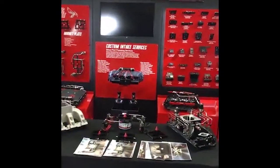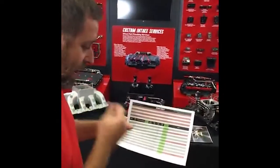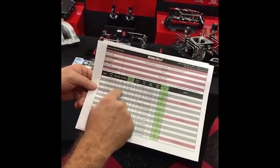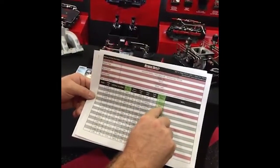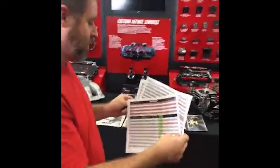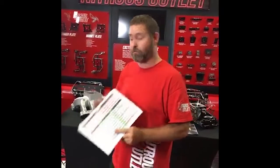Our goal shortly is for every one of our products to come with this flow data for free. This is a flow sheet for the Stinger 2 — it covers jet size, PSI drop in five seconds, pounds per five seconds, pounds per hour, horsepower, fuel jet, fuel pounds per hour at set fuel pressure, and your nitrous-to-fuel ratio, telling you where to start. Whenever you get our stuff, you get all this information and data for free — it comes for free. You can go to our website to the jetting page, find your plate system, and print it out at home. You guys that are advanced tuners: pounds per hour tuning is the way to go. If you pay somebody to flow your stuff and they don't give you pounds per hour, you got ripped off.